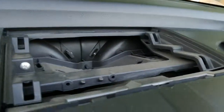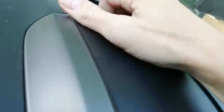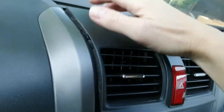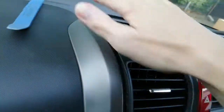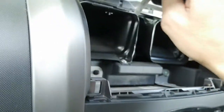Put that safely to one side. We're then able to grab the back of the heater panel because we're going to pull it forward. Now this can be tricky, so you sometimes might want to wear gloves because it's quite sharp underneath. Put your hand underneath and pull — you can actually wreck your knuckles pretty badly on this thing, so just give it a tug. These things can be really really stiff, so if it's never been off before and you can't get it to move, you can put your plastic leverage tool just down the rear and lever it off and it'll come forwards and out. There you go — it's on sliding clips, so it mounts into those holes and they are really stiff if the thing's never been in bits before.